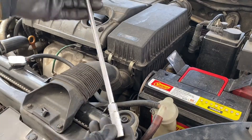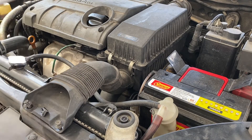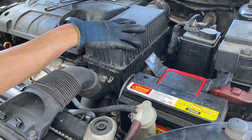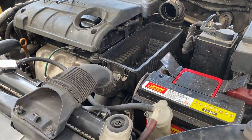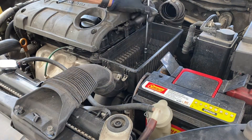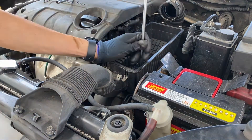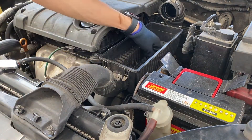In this video I'm going to show you how to change this engine starter. First, I use a 10mm T-wrench to remove the air intake filter box, which is secured by five 10mm bolts. Then remove the cover and also the surrounding clips so I'm able to get access to the engine starter.